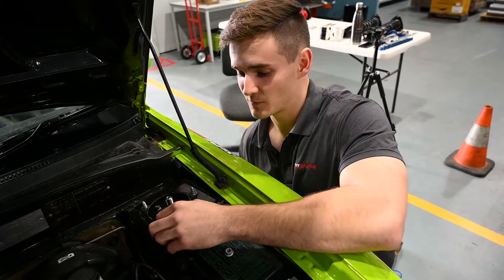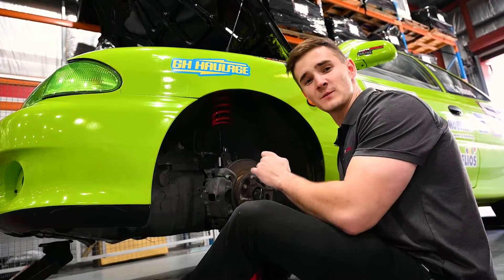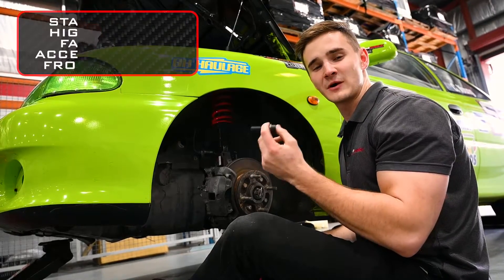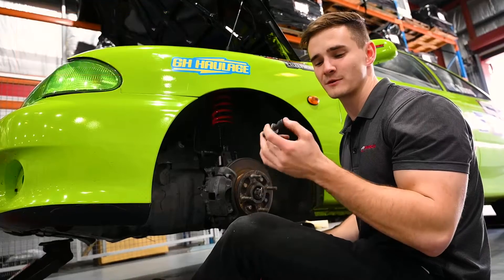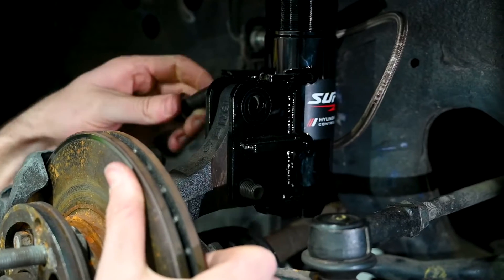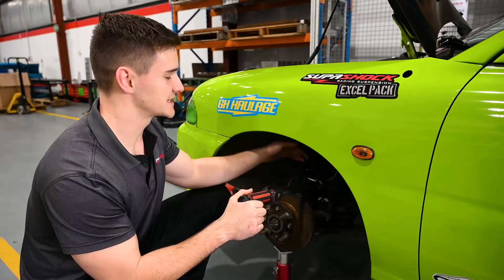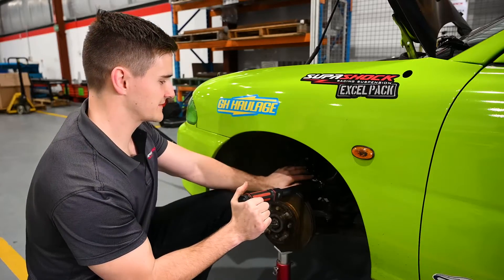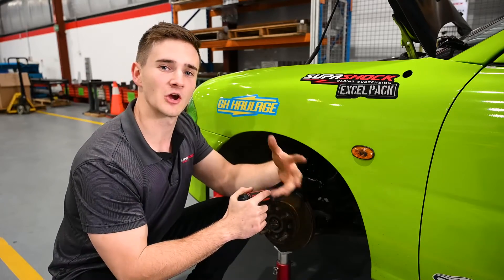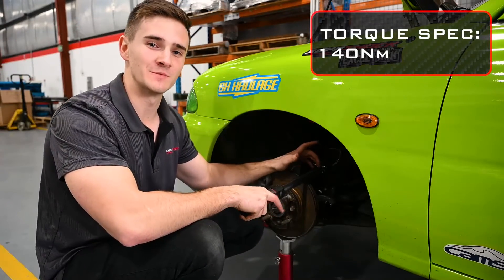I find it easiest if you put the top in first and put a couple of nuts on, that way you're keeping the top captive. If the coilover is suspended by the top mount, we can then offer up the hub to the lower mount. We're using the existing bolts and that's perfectly okay to do for the fronts, provided you've done an inspection and they're all in good condition. The trick when installing the suspension on the front end of the XLs is to nip up the lower strut foot bolts and then push in the hub and ensure it's seated correctly before you torque it. That way when you're bouncing off the curbs out on the track, it won't walk and change your alignment. The torque spec for the lower strut foot bolts is 140 Nm.